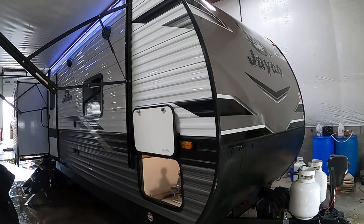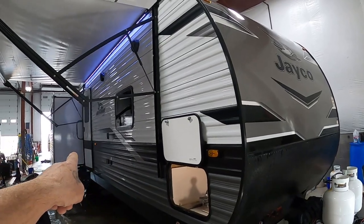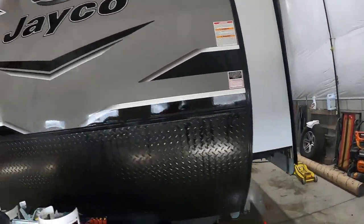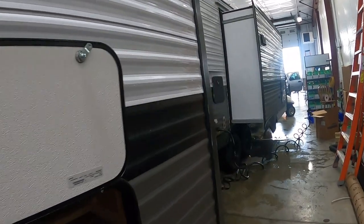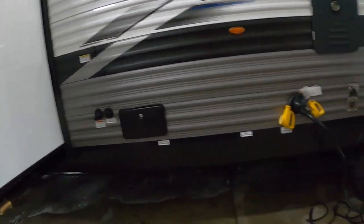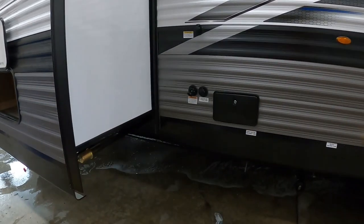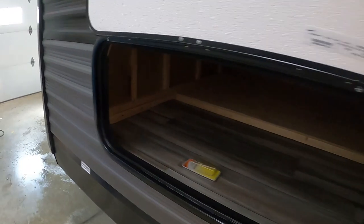Let's start by talking about arriving at the campsite and a couple of things to take into consideration when parking. On your campsite side, leave plenty of room for the slide as well as your big awning. On your off-campsite side, a couple of slides will need room, but also think about where your power and water connections are going to be — they're actually going to be in between the slides. Power is just in front of your tires on your driver's side, and water is about midway between tires in front of the unit. Park accordingly so you can utilize the facilities at the campsite.